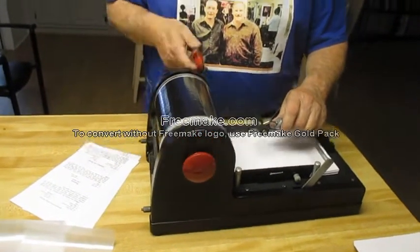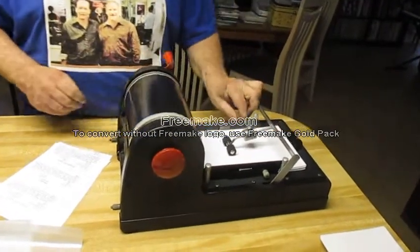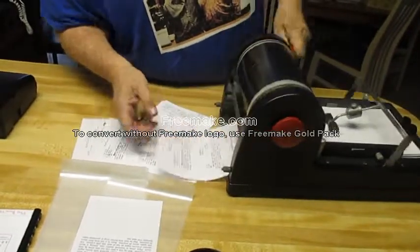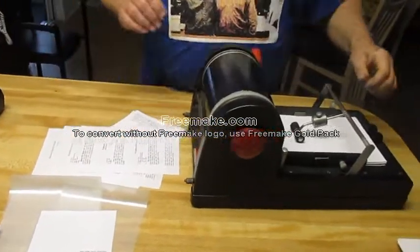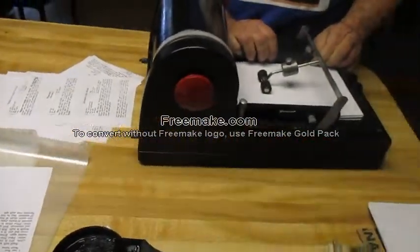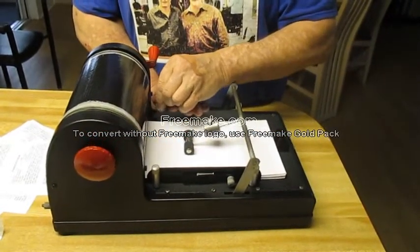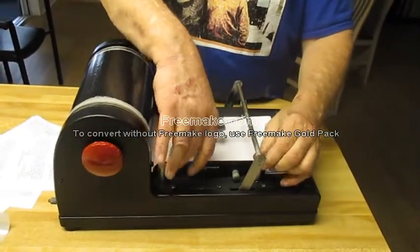Then reconnect the roller, let it stop, and tighten that so the paper doesn't come out in bunches. If the copy is off center, you need to loosen this and this and pull it back to create a little more margin. Loosen this and this and push it over — so pull that back and push this over and that will make the margin the center.